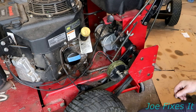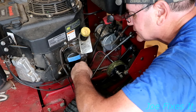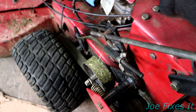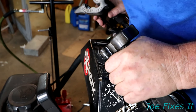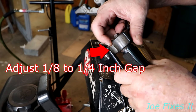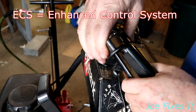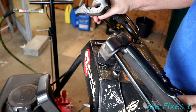Then re-hook your brake control and adjust your brakes. Run this wing nut backwards and forwards to adjust until, when you pull it good and tight, you have about 1/8 to 1/4 inch of gap between this and your handlebar on your ECS. That way, when you pull back and put the parking brakes on, it engages the brakes good and solid so it's not going anywhere.